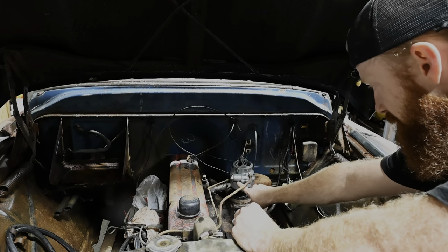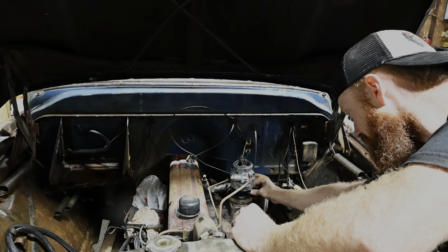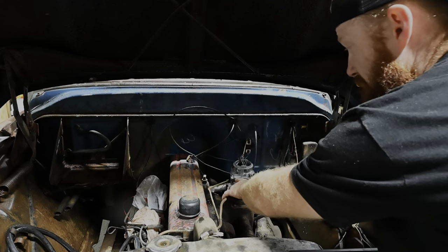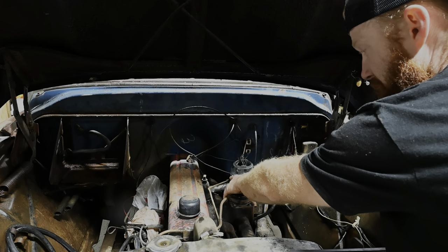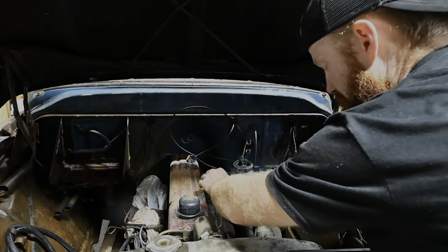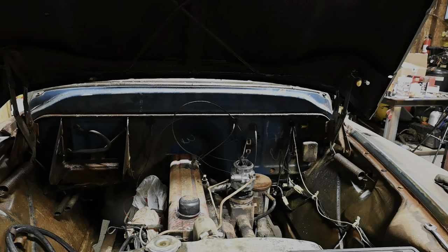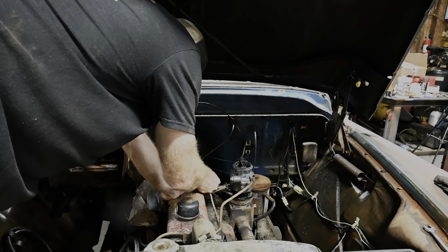A lot of our leakage was coming out around our bowl too. So, like I said, we'll just keep an eye on it whenever we fire this thing back up. Kind of see how it does. And as you can see, this gas line on the newer style carburetors goes this way, so we're going to have to do some bending and twisting on our fuel line. Unfortunately, I think our choke cable is completely froze up on the truck. I'm not even going to hook it up currently.